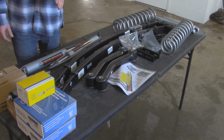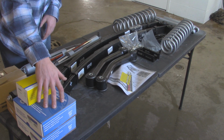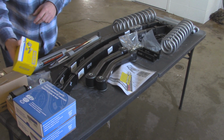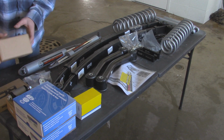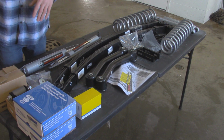So a few other things that I got that I'm going to replace while I'm in here doing the suspension lift kit. One is I got new upper coil seats for the front. Since this Jeep has 300,000 miles, they're probably all worn out. Along with that, I got some sway bar bushings. I did replace these a couple of years ago actually in this vehicle, but they seem like they got some wiggle room in there. I also got some extended bump stops that we're going to be installing in the front. I got a video for replacing the rear bump stops that I'll post in the description below if you want to know how to do that.